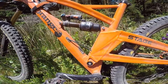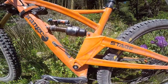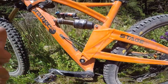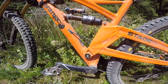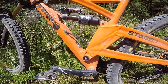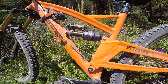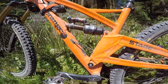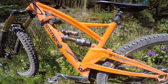You can tell through your feet almost immediately what you've done up here with the Fox X2 shock. The longer travel and longer stroke does need more tuning than the Stage 5 — normally bang a load of volume rings in there to make it more progressive so you can get more sensitivity off the start but still have it catching the big stuff. There is always going to be that higher level of feedback from that higher main pivot compared to a low pivot or four-bar more neutral linkage. It's just such an informative, feedback-rich bike — I'm doing all kinds of involving hand gestures here because that's how this bike rides. There are some brilliant bikes that feel totally neutral, but with Orange every time I ride them I'm like, how can this be so good? How is this such a fun bike to ride?